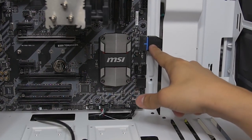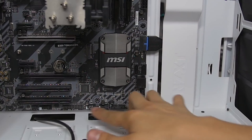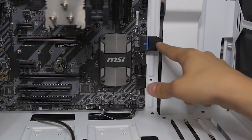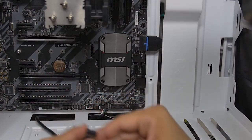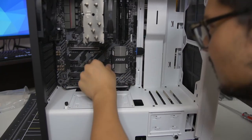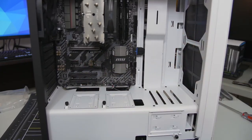Power switch is plus and minus — if you're not sure which way is plus or minus on the switches, you'll see a little arrow indicating positive, and the side with no arrow is the ground. Then the hard drive LED — little bastards are all plugged in. Moving on to USB 2.0, which is right next door — this is also keyed as mentioned. If one of these pins snaps off on any of these headers, you're pretty screwed. Also, if your motherboard has two USB 3.0 ports, they're effectively identical — it doesn't matter which one you plug into. Then this is the HD audio — front panel connectors are installed.